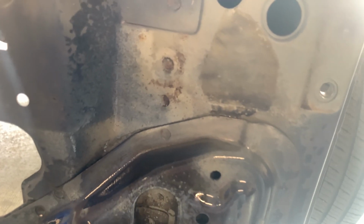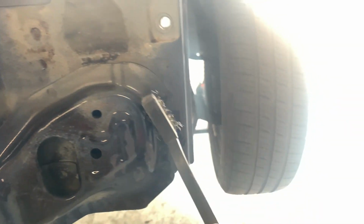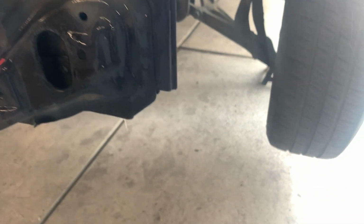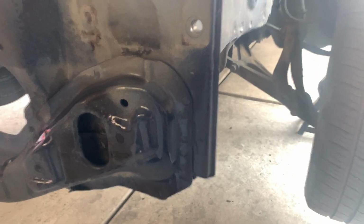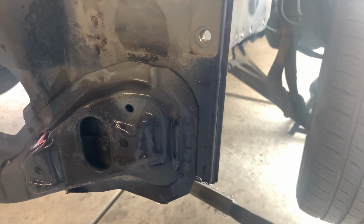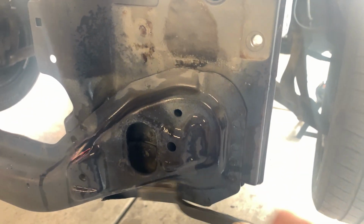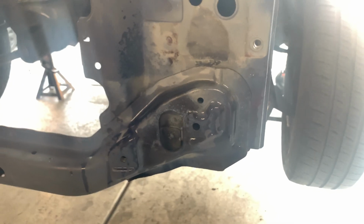You see how that spot weld right there is more evident? There you go. See that? Just do that. Go around the edges. Clean it up, and you see how all those spot welds right there? Watch, 1, 2, 3, 4, 5, all of them right there. All those little dimples. Just go around, clean the whole thing.